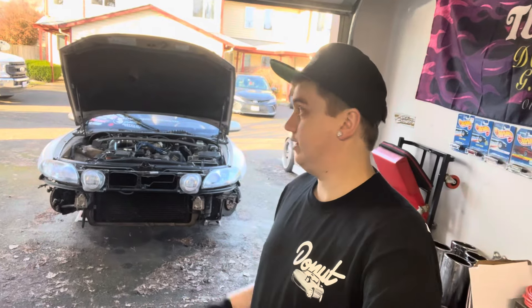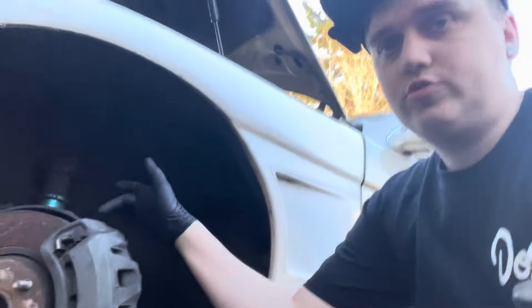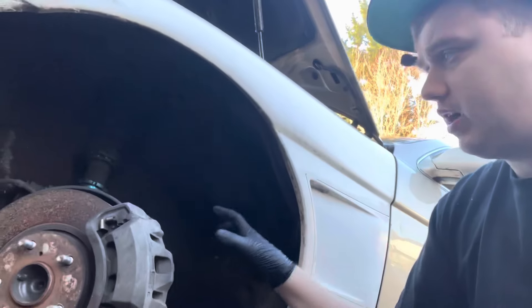So as you can see here, I have the car up in the air, the bumper and wheels are off, and I'm going to show you what I'm about to do. We've got our stock brakes and stock rotors here. Basically what we're going to do is take the two big 17mm bolts off the whole brake caliper, let the caliper hang to the side, take the brake line off, take the rotors off, and then the dust shields will have to be removed — or you can trim yours down, but I'm just going to take mine off.